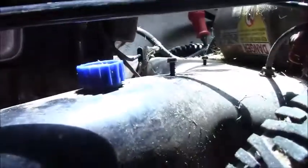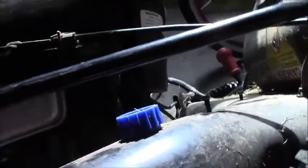Now we got to get the belt cover back on underneath. So in general we're going to try to balance the bolts at the top with the bolts at the bottom, and then tighten them all up after you get them all finger tight. Plastic cowling in place. Get a 13mm bolt at the bottom and the 2 10s on top, finger tight. I'll tighten them down.